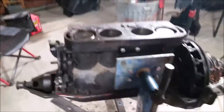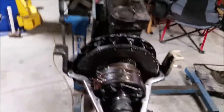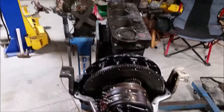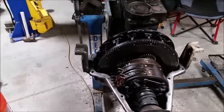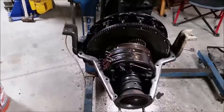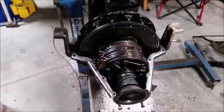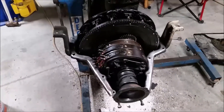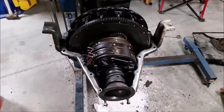That's the progress report. Next, I'll get the valves lapped in and cleaned up, make sure everything's okay there, and then the head and hog's head will go on. We'll get all that done, get everything adjusted up, and get it back in the car. I hope to have it running before the car show on Friday.